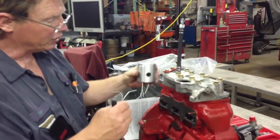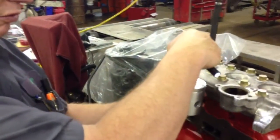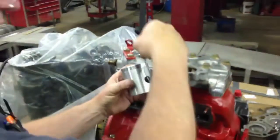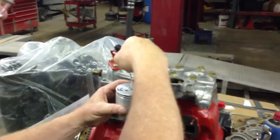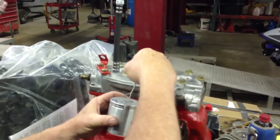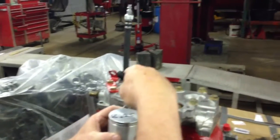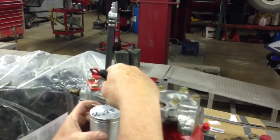When I do this test, I want to do it even with the wrist pin, so as I come into the cylinder bore here, I'm going right along here, even with the pin, so that when I come up it can't rock. If I do it on the other side, the piston will rock and give me an incorrect reading. Saab shows in their book using almost like an umbrella type, so you're doing it with two of them, one on each side.